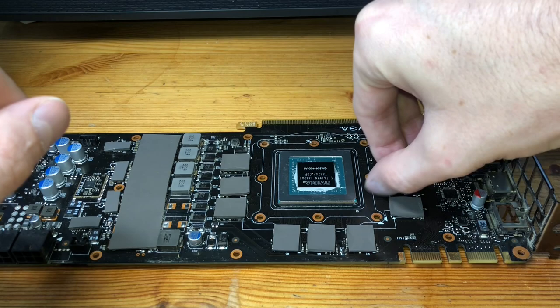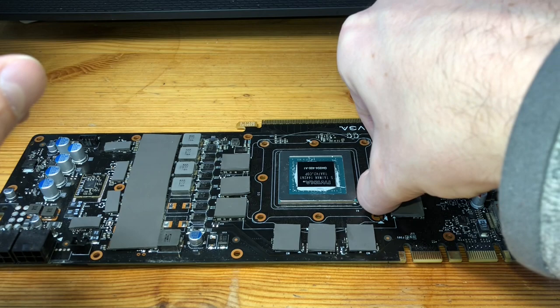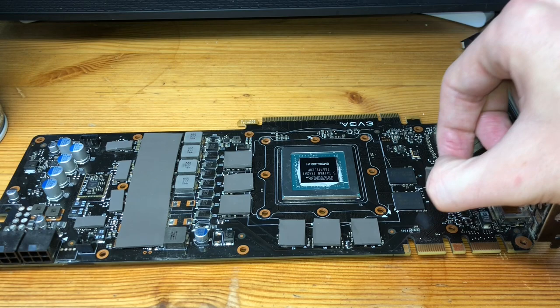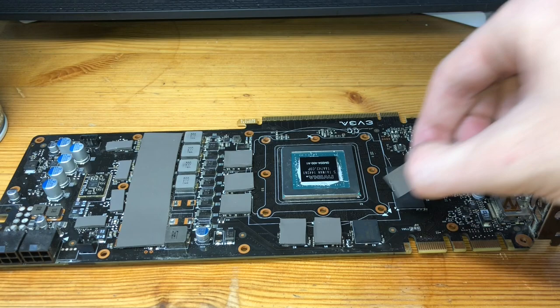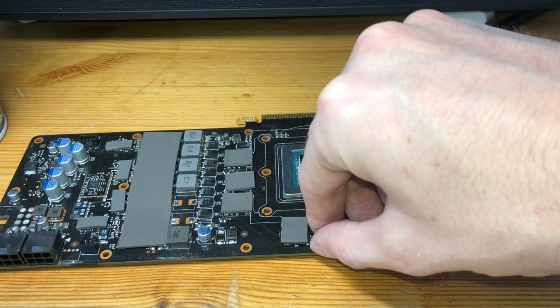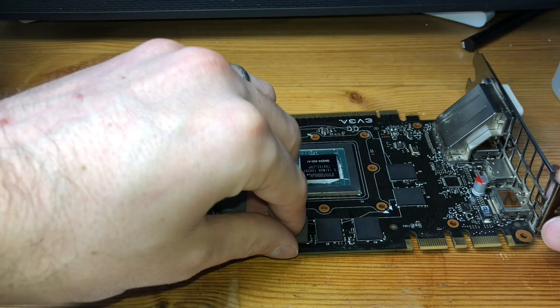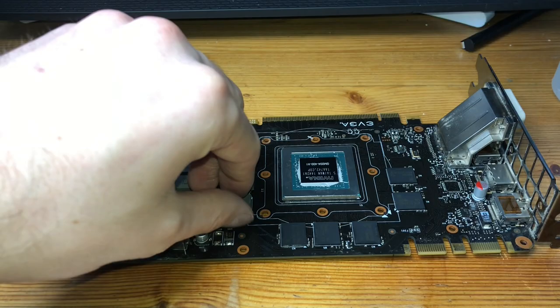And thermal pads you can go ahead and keep and hold on to as well. They're nice and sticky. So I'll put this in my parts tray. And the process we're gonna use for applying the heat sinks, we're gonna use an adhesive thermal paste. So it is one that is gonna lock these heat sinks in place. So just bear that in mind if you're gonna be doing this and not exactly sure if this is a permanent solution, because anything we adhere here, it's gonna stick to the card and make it not very easy to put the reference card back on.